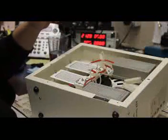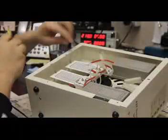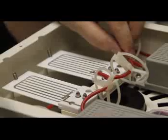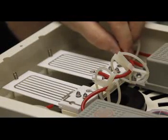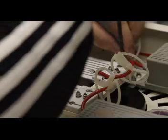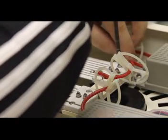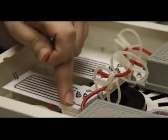Alright, then go ahead and pick up your screws and place them into the little eyelet rings. Once you have them in the eyelet ring, do them one at a time just to make it easier — if you put all the screws into the eyelet rings at once they'll fall out as you go. Make sure you don't over-tighten these either, because if you do, it will crack the metal that transfers electricity from the high voltage transformers to the plate itself.